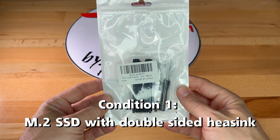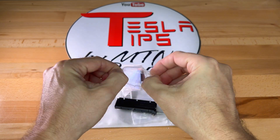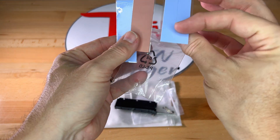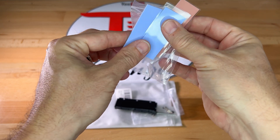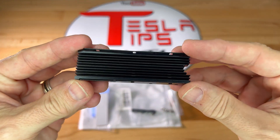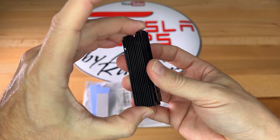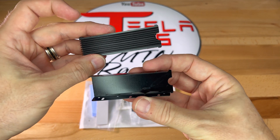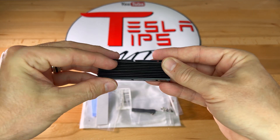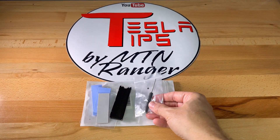Here is the KBR Parts heatsink that I purchased. It contains a lower metal section to cool the NAND chips on the bottom of the SSD, and a top heatsink to dissipate heat from the flash controller and NAND chips on top. It should include two blue foam pads for the top and bottom areas; however, mine just included one — luckily, I had a spare. The package also contains a grid of smaller heat pads that can be used on areas that are lower on the SSD to even out the surface if needed. For example, the flash controller may have less height than the NAND chips.